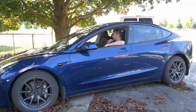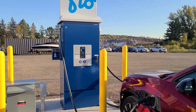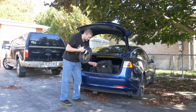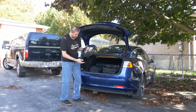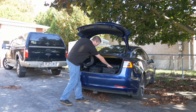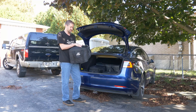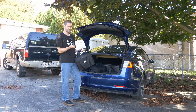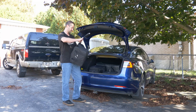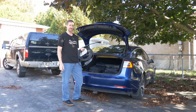I forgot to stop and charge before I got here. I don't want to go to a fast charger in the morning — I've got my EV Dance portable charger here. This works in a couple of different places: I can use a 6-20 outlet, or there's an adapter included so I can trickle charge too. It works with 120 volts and 240 volts, so here at my friend's house I can definitely get the car charged up at least a little bit overnight.